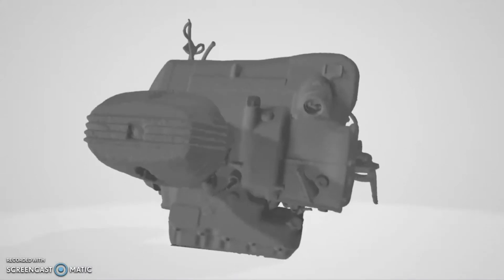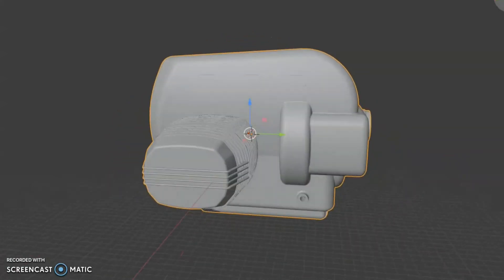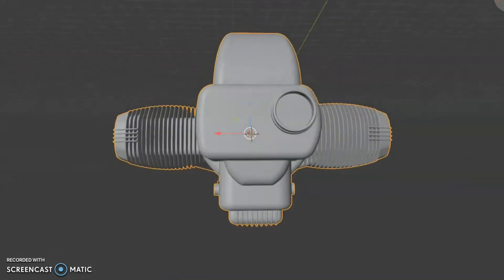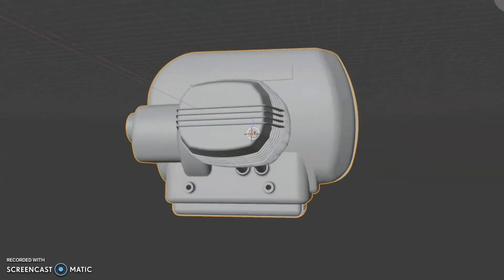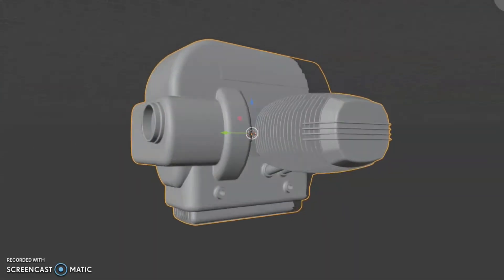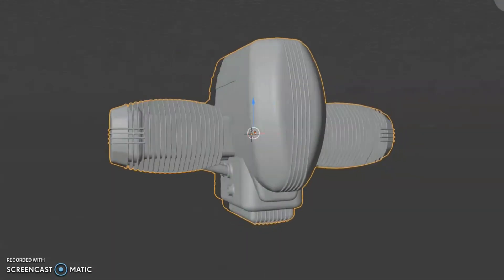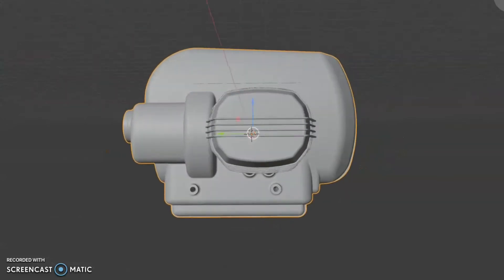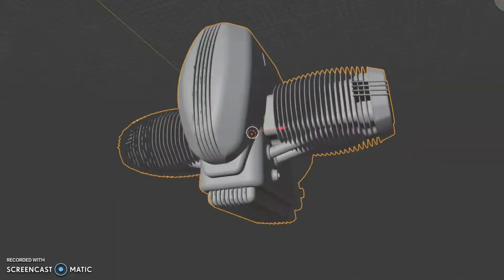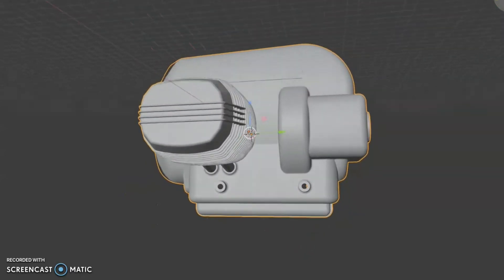This has got to encase the batteries, so we need as much internal space as possible. Here's the finished product — it looks very similar; I've had to change a few of the shapes slightly but it's still very much dimensionally the same. I've decided to use Mitsubishi Outlander cells for this build — 40 amp hour cells configured to 72 volts and 80 amp hours — and I managed to pick up a whole pack for fairly cheap, so it should do me for the next couple of builds.